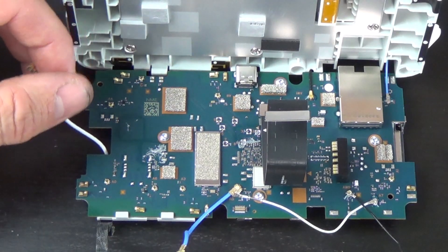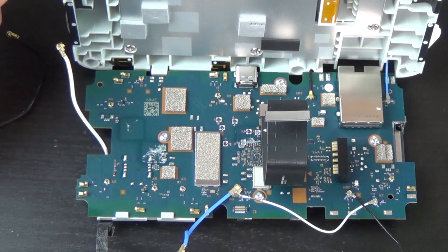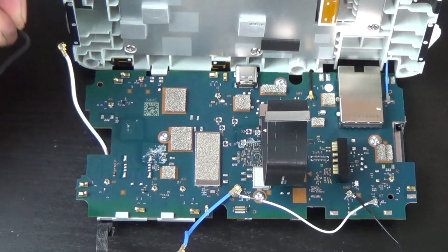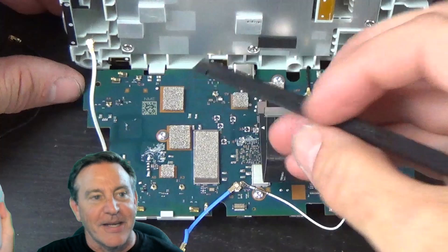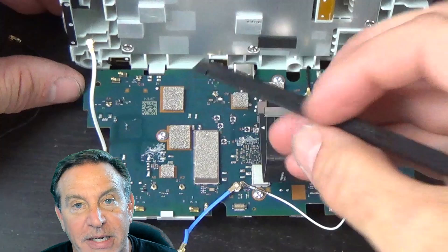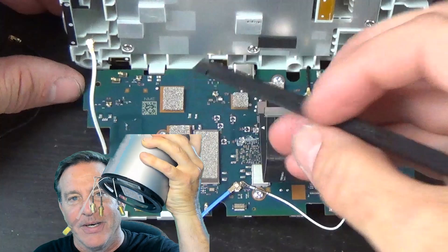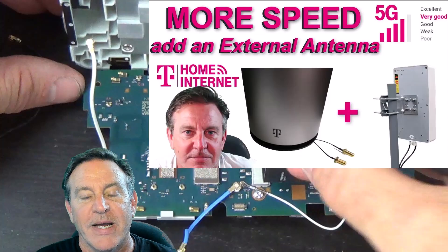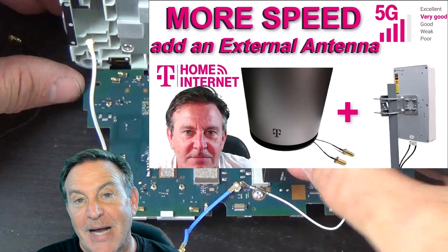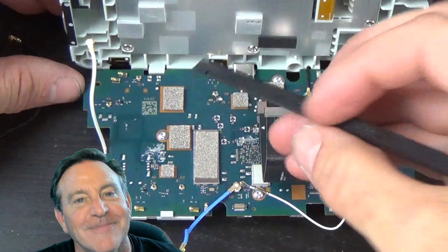Looking around to see what else I can find, but this is basically what we're looking at. There is no easy disconnect-reconnect solution. As you've seen, I've gone a bit beyond my comfort level — I've taken a ton of stuff apart. Glad I got this on video so I know where everything goes. Well guys, I got it working again. You can see by the blue light that it's back on the network and pulling in 5G — it actually works pretty well. It can be taken apart and put back together. I have some IPX4 connectors to try bringing some of those antenna leads out, but I think the easier way is to use the original can and break out the leads that way — much easier connectors to work with.